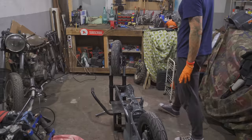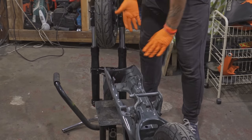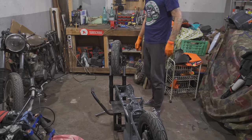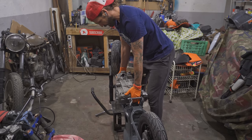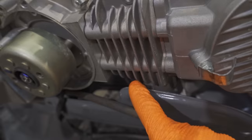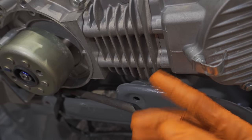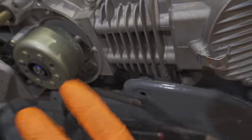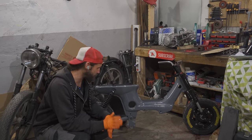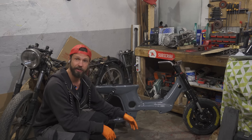One of these tabs is in the way of making things fit. So I'm gonna take the engine, turn it around, put it in and see which one I need to cut off. This side I need to cut off — you see this tab here? The inner one. It's literally obstructing the engine from entering. Right about now I'm really happy that I painted this frame. I need to cut this part out to be able to put the engine in. Angle grinder and let's go!